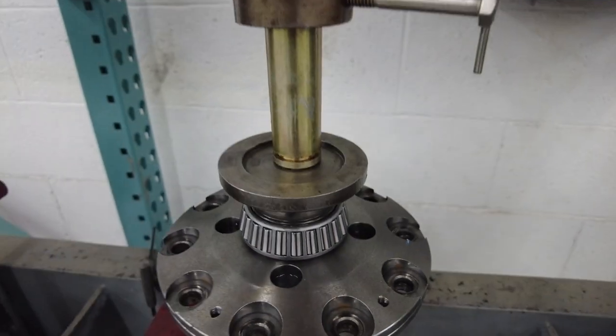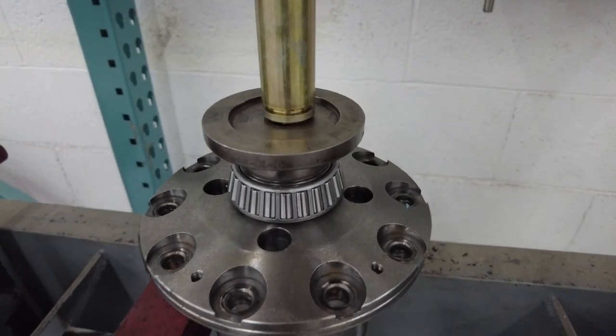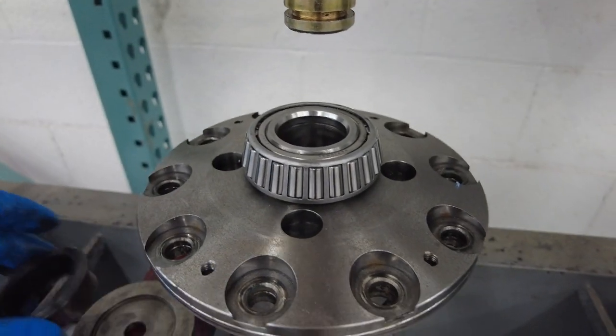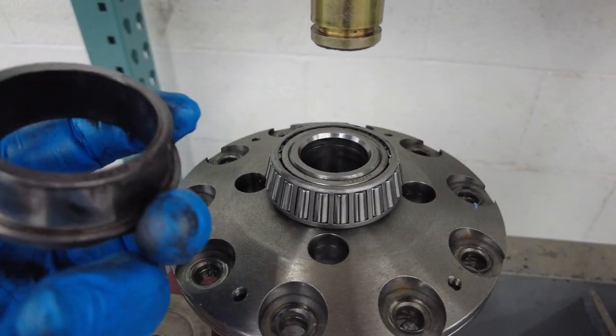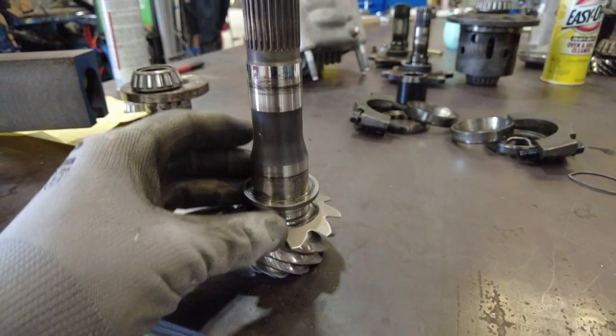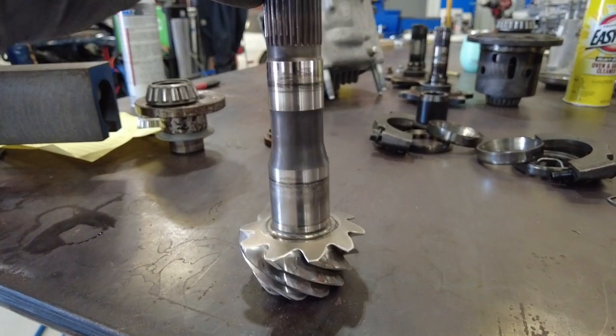Two down — let's clean this off and grab some fresh ones. Always try to consider these bearings and races a matched set; I have put some indications on them so we don't mix them up. Let's get these bearings pressed on. Quick tip: I used an old bearing race to start pressing this on, but I only pressed it until flush — the bearing is not all the way seated yet. The perfect thing that's going to fit to press it fully is the old bearing itself. A little bit of sanding and I was able to sand through the cage so we can pop the race out and use it as our press tool.